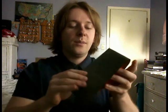As an alternative, you could use this sanding block, where you would insert this type of sanding paper and put it right in here to create another sanding surface and use that instead of the sponge to remove the rust and paint from that ledge. Using a drill with sanding discs would not be appropriate to remove rust and paint from that ledge. Now 80 grit sanding paper will be the right type of paper to use in order to remove that rust and paint from that ledge.